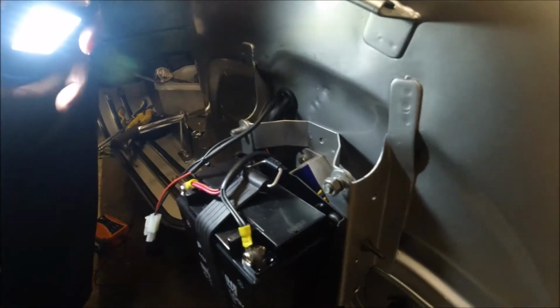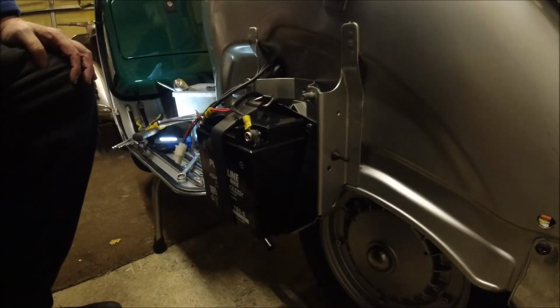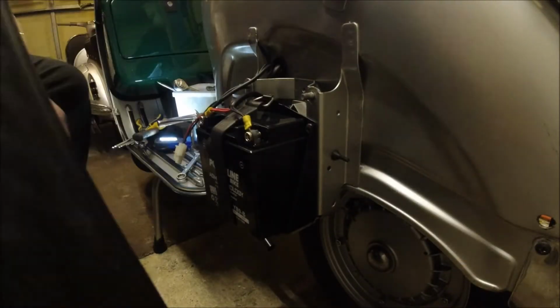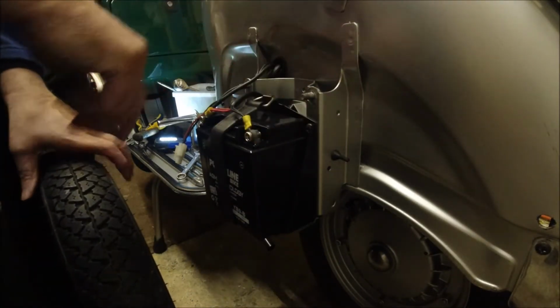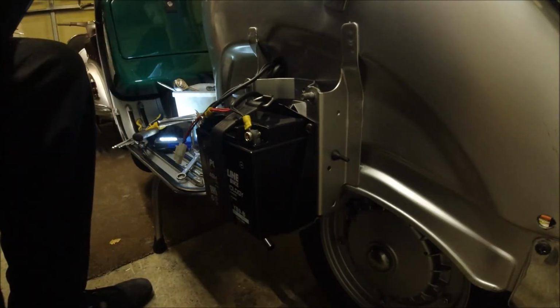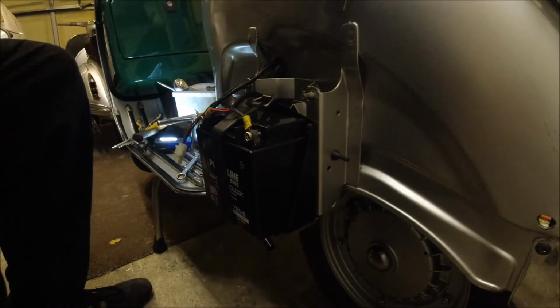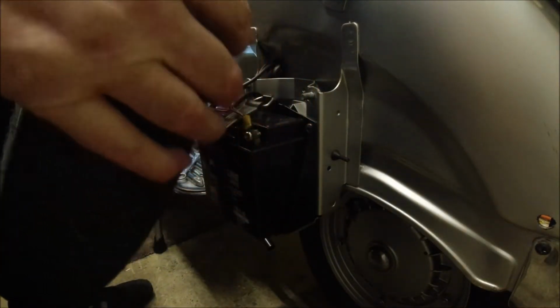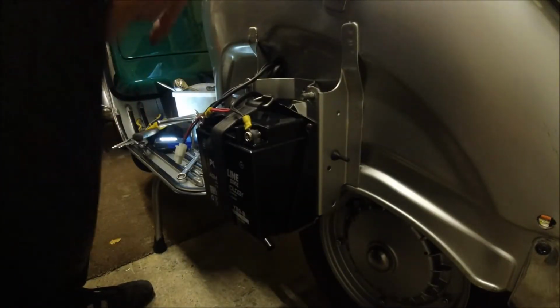If you've got anything fitted like that, then it's no big deal. But right, just going to pull away till I get the spare wheel. Right, so I've got my spare wheel, and what I suggest you do is put the valve either here or here, depending on how your wheel sets up, and your deep part sits towards you. So the shallow bit, all the bits with your bolts on, sit towards you, and I always put the valve up this side.